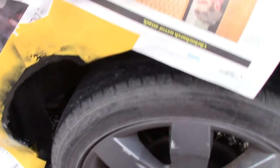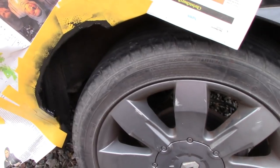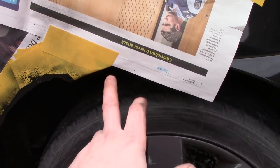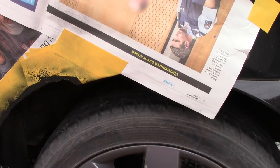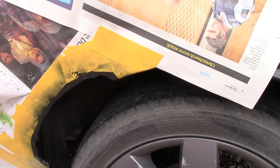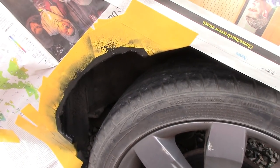I've silicon sealed it and just boshed some paint on it. It won't stop it rusting — it's gonna keep getting worse because the whole channel up here is rusty and the whole arch needs to come off, which is way beyond my skill level. The only thing I can think of is finding another Clio, cutting the arch off, and welding it on here. I think that's the only way to go.